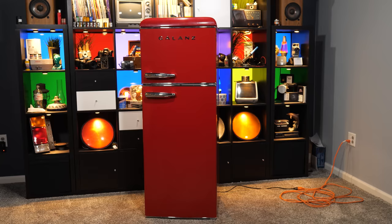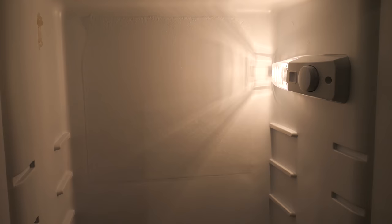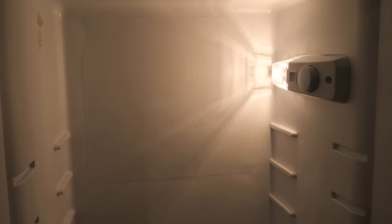I wanted to know for sure just how bad — or maybe good — this fridge is at being a fridge, so I needed to test it somehow. I wanted to test two specific things: first, how long does it take to cool down a large quantity of stuff? And second, how uniform are the temperatures inside the fridge? My experience with it gave me low hopes for its ability to chill things quickly, and with the evaporator being at the very back, I suspected there would be a pretty severe temperature gradient inside. But I couldn't really get a sense of how uniform the temperatures were with a single thermometer, and monitoring manually would be pretty annoying.